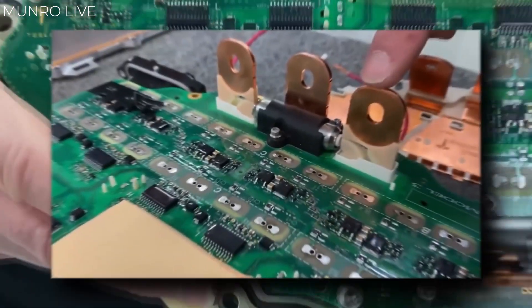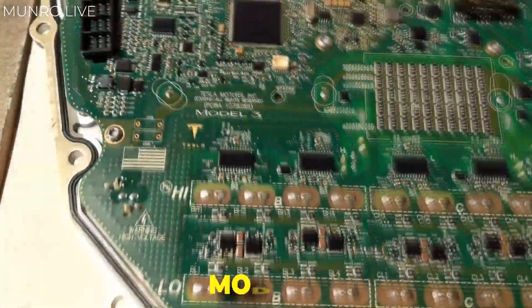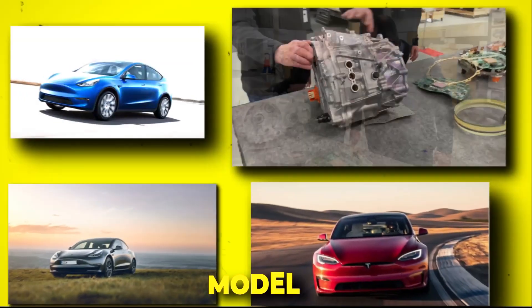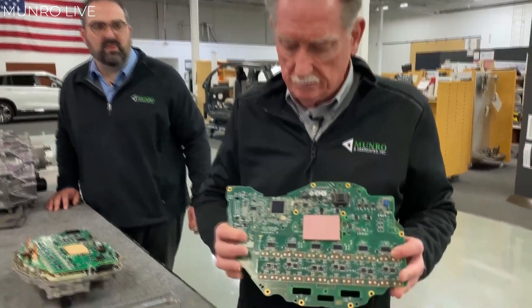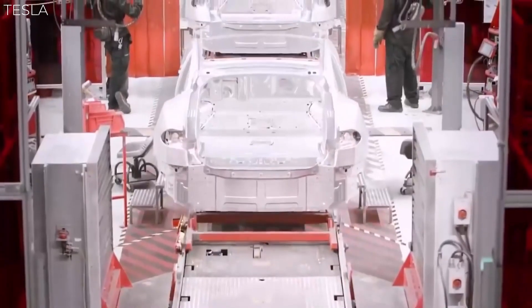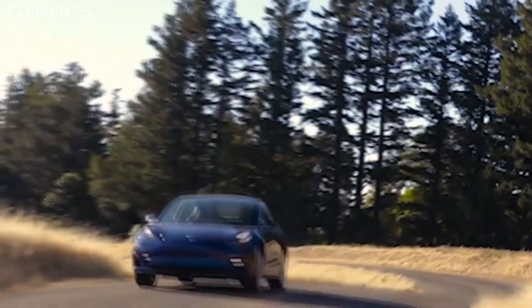What's interesting is that the inverter board inside each of the Model S Plaid motors actually states 'Model 3' right on it. Sandy goes around demonstrating that every Tesla motor — whether it's the Model 3, Model Y, or Model S Plaid — has the exact same inverter. The housing is the same on each motor, and the circuit board is very nearly similar, with only one important change on the Plaid. So when we talk about Tesla prioritizing efficiency in their production lines, this is what we mean. The same basic component goes into every car — they don't even waste time changing the printing on the board. They all say Model 3. This is the inverter that Tesla created for the Model 3, and they liked it so much that they implemented it into every single motor in the lineup.